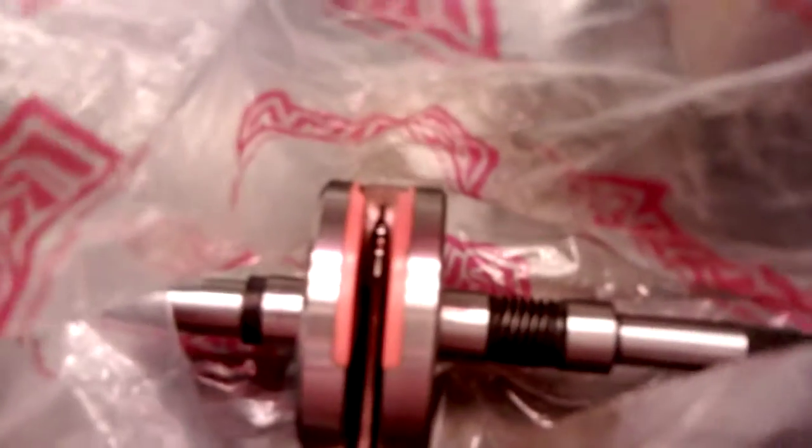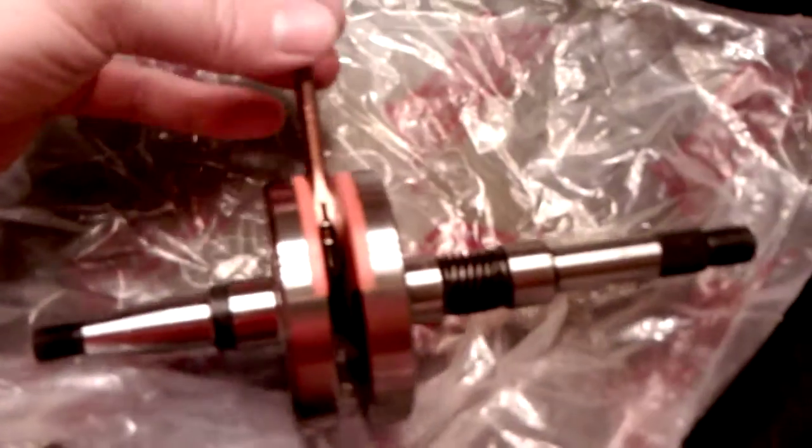Here's a stuffer, is what they call it, which means it has plastic inserts which allow higher revs than a normal crank. Very nice. Heat treated all the way through. 44.1mm. Full circle. Balanced. This will allow you to go 70 plus miles an hour with a 47mm big bore. Excellent quality. Right there it says Ruma Dio and it says 44mm.